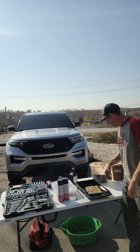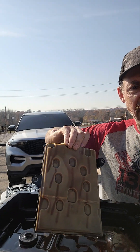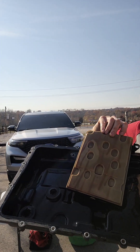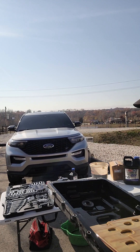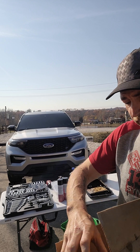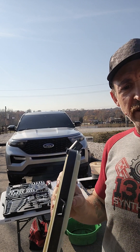To wrap up: we're going to put five and a half quarts back in. The big difference in the filters — the OEM filter is pretty basic, it's got a little funnel. On the 10r60 pan you can see two magnets. On the 10r80 with the factory pan there's only one magnet in the pan — they put a second magnet inside the filter, so the 10r80 still has two magnets total: one in the pan, one in the filter.